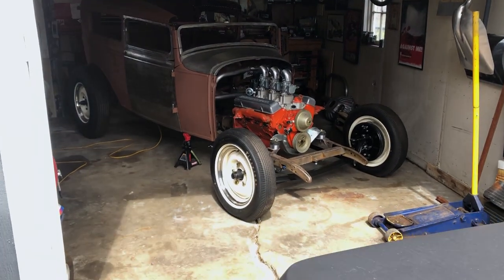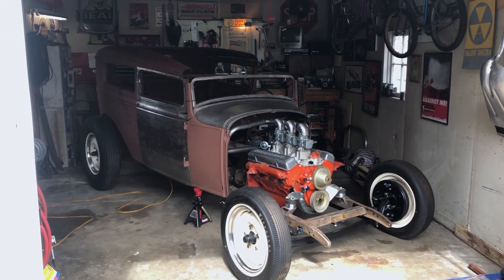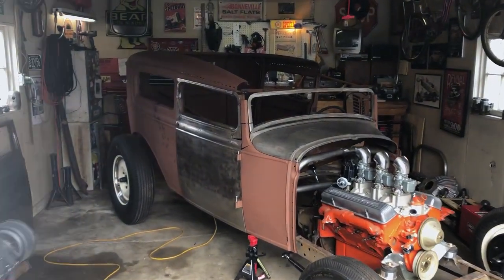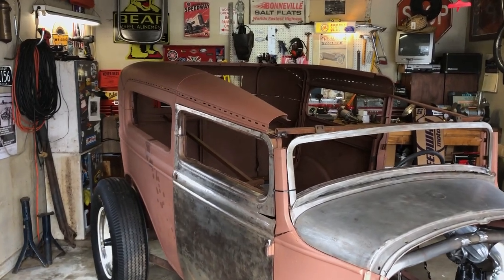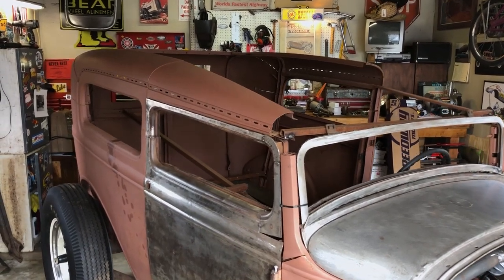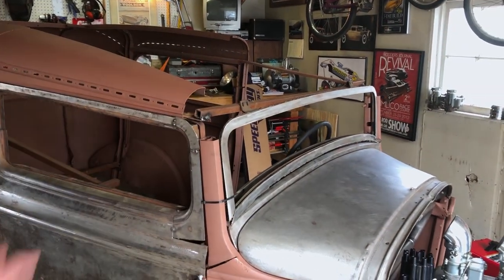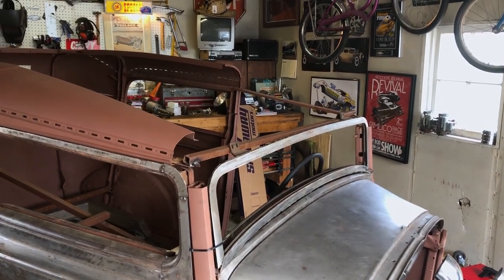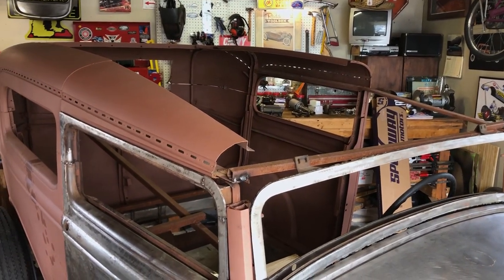This is a 1930 Model A two-door sedan, building it like a 50s era hot rod. It's got a six-inch chop and a Chevy small block. The top is all kind of hacked together at this point — everything is basically just tacked and being held with zip ties. The windshield frame is zip-tied on right now, and the idea is to make it look a little bit more like a Lakes racer, lay the A-pillars back and put a fabricated windshield header on it to look a little more like a '32. There's some square tube bracing just tacked in place to keep the body from falling in on itself.